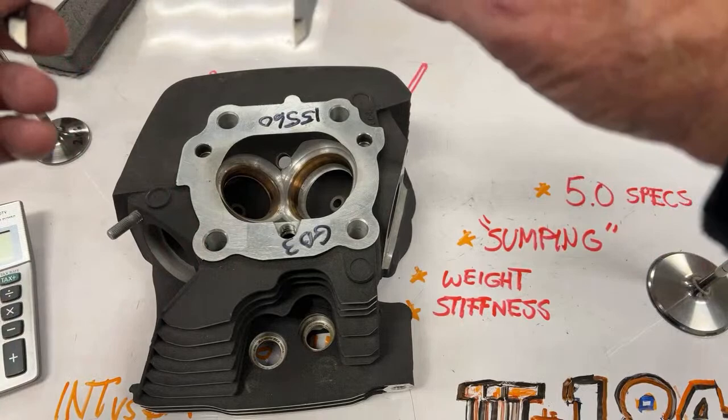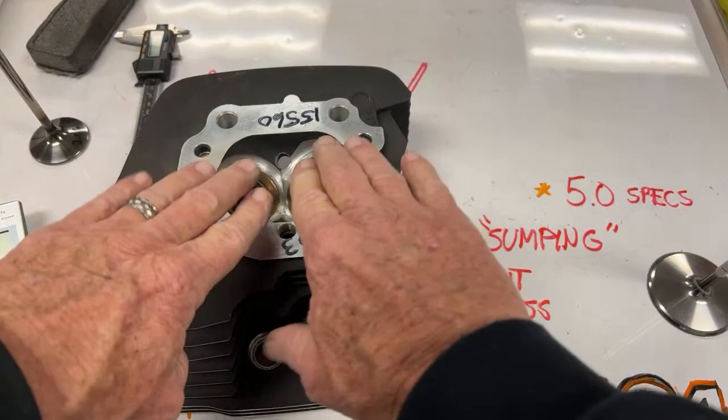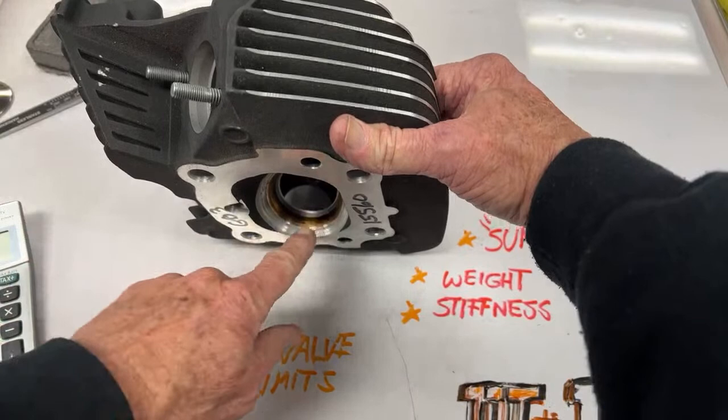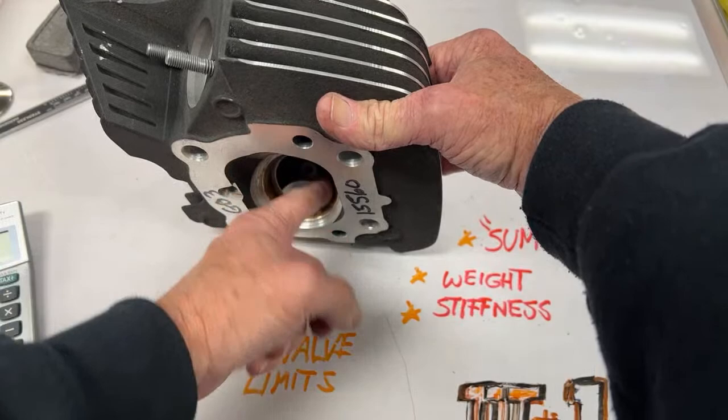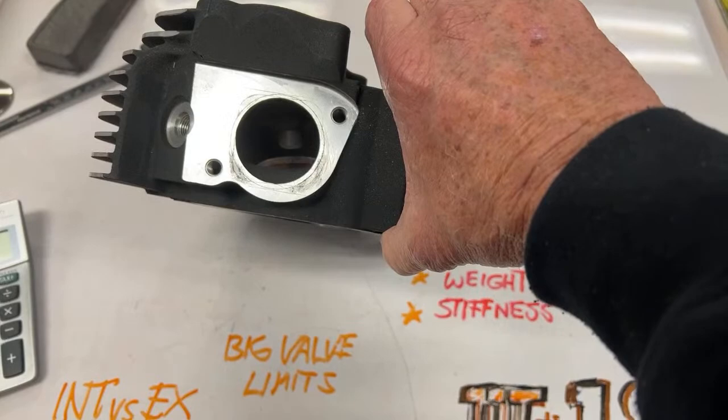to bore out, to put a big enough cylinder in it for me to clear, because I had one goal in mind, and that was to put the biggest valves I could. So I put the biggest one that would fit, and Ron had to sink them, sink them, sink them. Another thing that happens, that's no good. The more you sink the intake valve, the more short turn radius you run out of, because we're getting closer and closer to the turn. So there's just no short radius here to make the turn. This air comes in on these Harleys pretty much straight in. And before it can get in the cylinder and make any power, it's got to make a turn and go in the cylinder. And we need some area to make a short turn here.